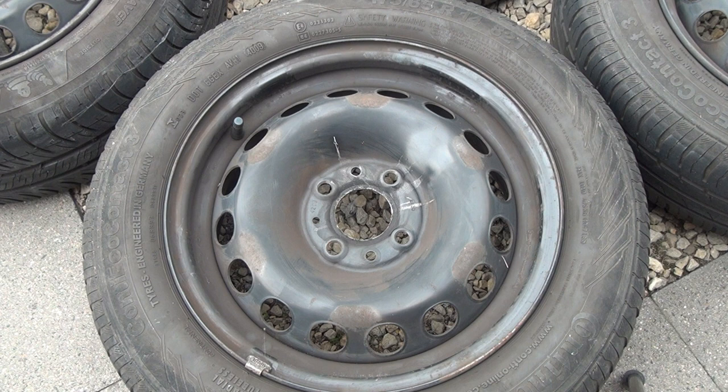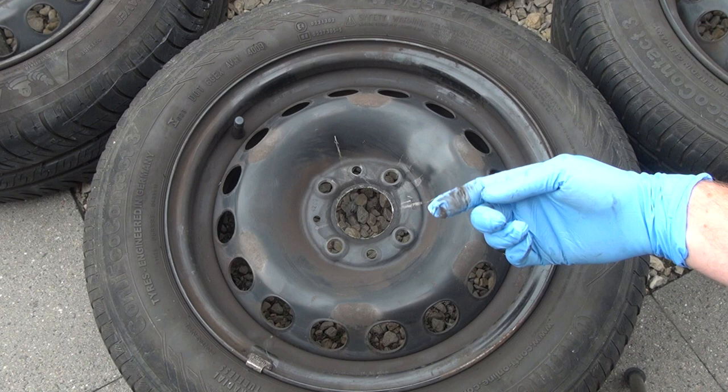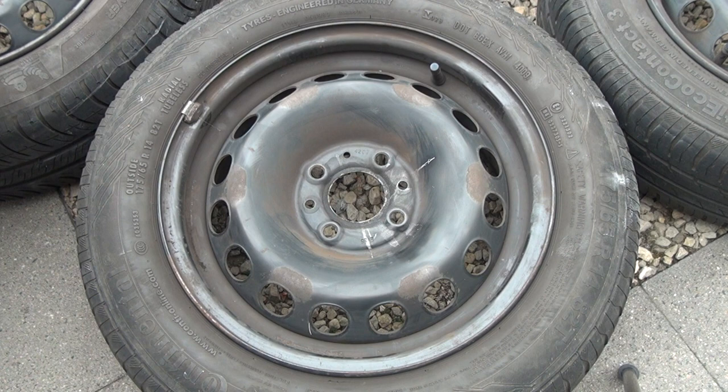But I will leave the tires on the wheels, because it is much easier to stack the tires while repainting. These rims are quite dirty, have some scratches and rust — especially at certain points. It is still shallow so restoring will be no problem. The first step in preparation is removing the wheel weights, after which we will wash the rims and remove all rust before prepping for repainting.